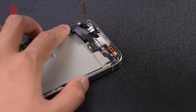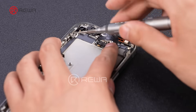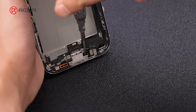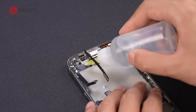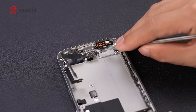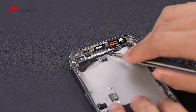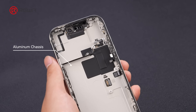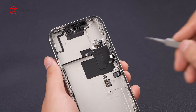Let's continue with the remaining parts. Remove the microphone — the microphone is no longer integrated with the charging port flex cable. Apply some ethyl alcohol to remove the charging port flex cable and the antenna. This is the new machine chassis made from aluminum — the new graphite clad aluminum substructure.